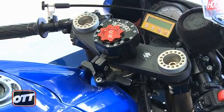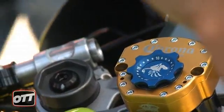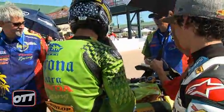You turn the dial to get your stiffness setting. The end of it has a needle and a seat, and the more you turn it up, the closer the needle gets to the seat and the less oil flows through the orifice, so the steering gets really stiff to turn from side to side.